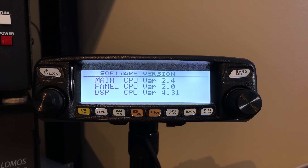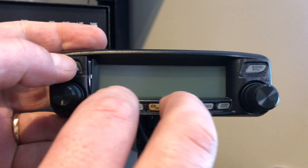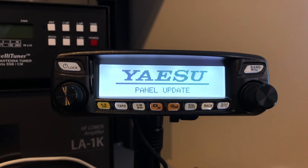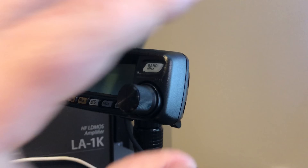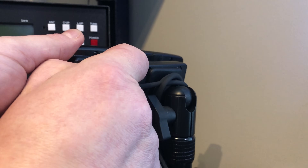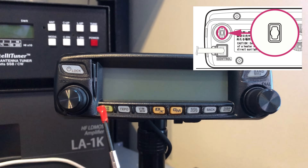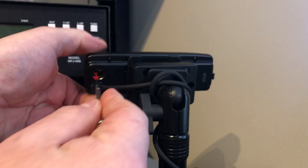Let's go for the panel update. Select COM5. Press TXPO and GM key plus power, and then it will ask you to press display — press display. Now you will have to flip a switch, but you don't unplug the radio. You'll need a plastic screwdriver, or one like mine with electrical tape on it to make sure you don't short anything, since the radio is powered. You have two switches: the first is the little black switch on the left. Grab the panel, check it closely, and flip it. The other switch is a push switch — push it and it will flash. Now you are ready to update.